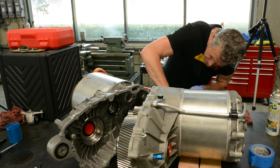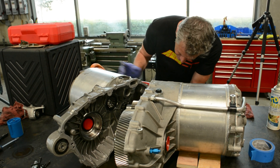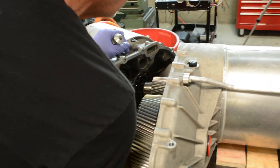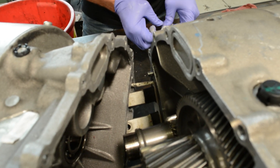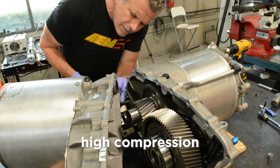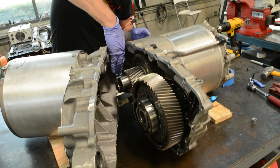No leaks and no blockages. So what type of silicone are you using? This is Permatex Ultra — it's referred to as a gasket maker so it works with cases as well. It can work under really good compression. In some cases you'll have a silicone that'll compress and actually squeeze out like a jelly. So really good quality, high strength, high compression — it can take high pressures, high temps, and obviously different fluids.